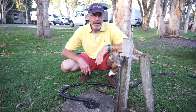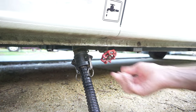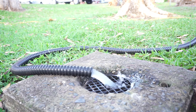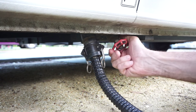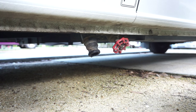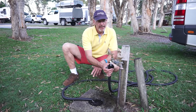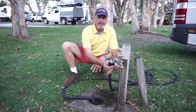All we're going to do is lay this hose right here and open up our gray valve all the way. You can see that this small gray water hose doesn't empty the tank particularly quickly, but it gets the job done. Once the water is completely drained out, close your gray valve, flip up the two tabs, and disconnect your hose. If you have water available, rinse out your hose — gray water can smell as bad as black water, and with this hose sitting inside the camper van, we'd rather have it rinsed out.